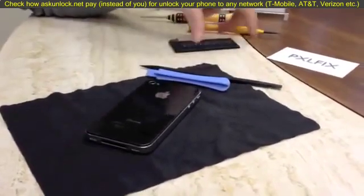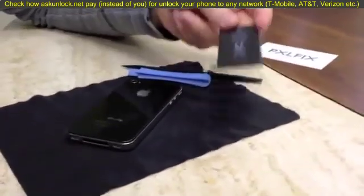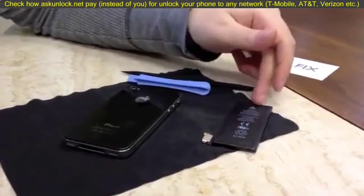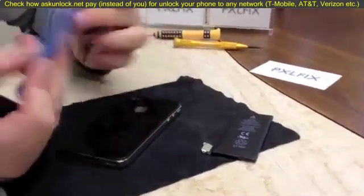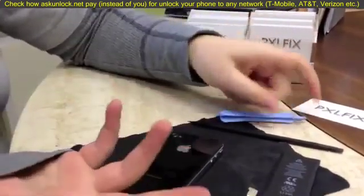What you're going to need for this is obviously a new iPhone 4 battery. The way you typically diagnose this is if your phone's not turning on, or it's turning off the minute you unplug it, you probably need a new battery. You'll also need some type of plastic pry tool — whether you use one like this or another style is completely up to you. I typically use both for different things.